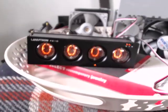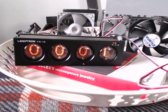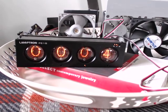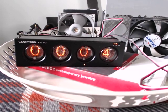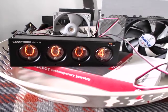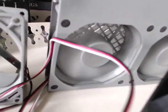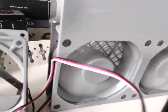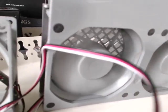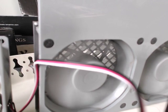So it's on voltage, so I'm going to take that voltage up and we'll see where those fans start to operate. At 2 volts there's a twitch, and at about 4 volts they start up. I will now move the camera a bit closer. It's got the microphone on it. I'll move it closer to the fans so that you can hear the change in fan tone as I go up by voltage increments. This is at 4 volts and the microphone is about 10 centimeters away from the fans.